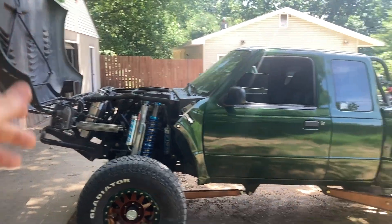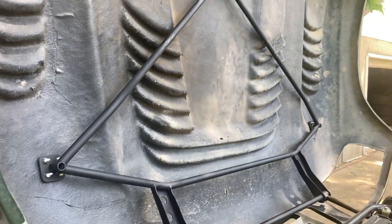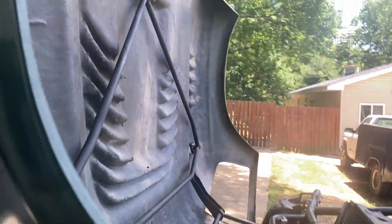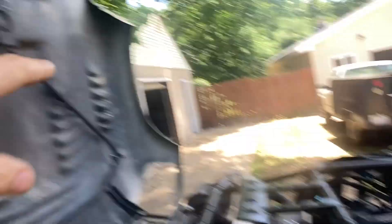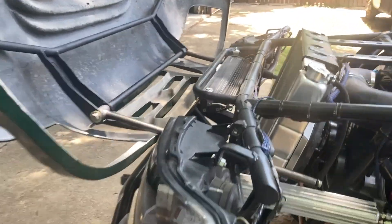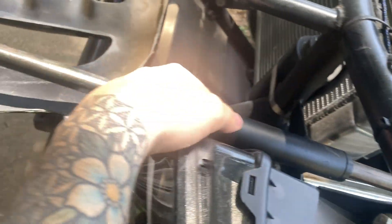So it's on the stops, it's leaning forward. There is more room for it to pull out and slide further yet — that's not fully extended. But you can get a look at the framework under there. That's all bolted to the fiberglass. Those aluminum blocks are bolted to those standoffs — that's how it's attached and what's holding the weight as it leans forward. When the hood is down, the front end is held in with pillow blocks, and these locate with knobs on that piece, and then latches hold it down. This is a fiberglass pre-runner style tilt-forward hood design.